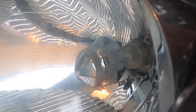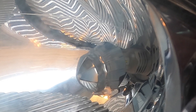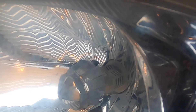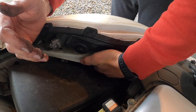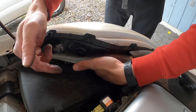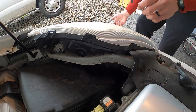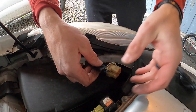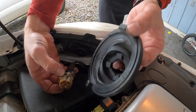It's really helpful to look at it from this side because you can watch as you're getting the headlight positioned in there, and you can feel it when it's in the right position. Once it sits in there nicely, you're holding it and then you've got to get the clip back on. It's basically a spring clip — you've got to get the tension on there, and then the little tab locks down. Push it in and kind of down, and once you get it right the headlight is sitting in there on that spring clip.